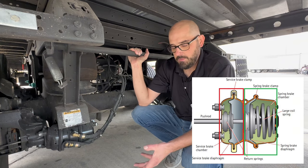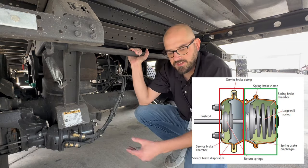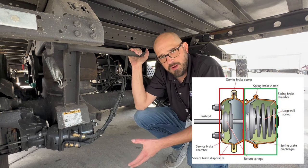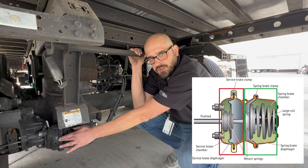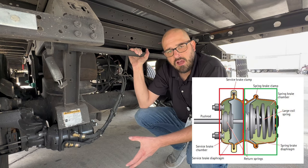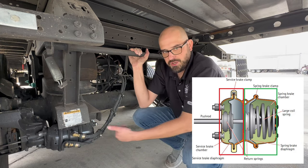I'm going to go over both sides. First, the side that's closer to the brakes themselves — that's going to be your service brake chamber. Your service brake chamber is working when you're going down the highway and you press your brake pedal, and that's the only time it does anything. It has no spring in it; it's just an empty diaphragm, an airbag basically. When you press your brake pedal, your service airline system charges with air and fills this up, which pushes the rod out.